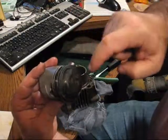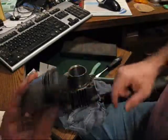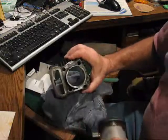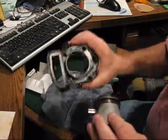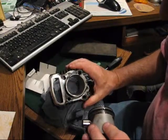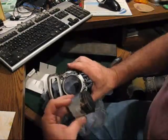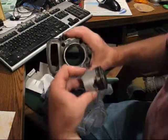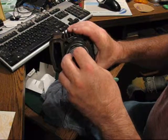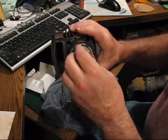The larger clearance cut is the intake, and it has an N cast into it — N as in November. Looking at the bottom of the jug, the intake side is the upper portion. The cam chain pocket is going to be on the left looking from the bottom. So the intake side of the piston goes that way.